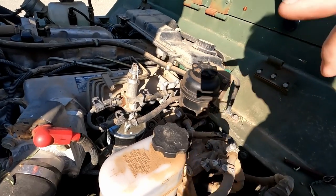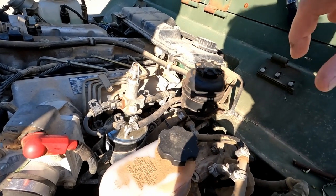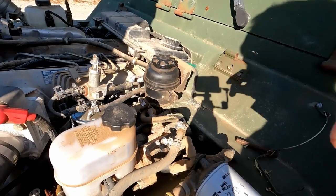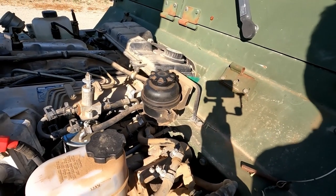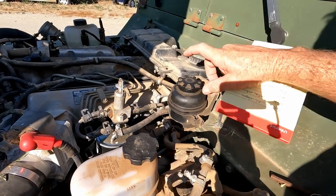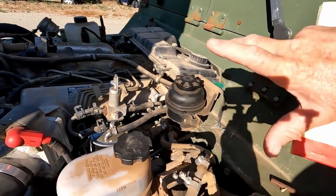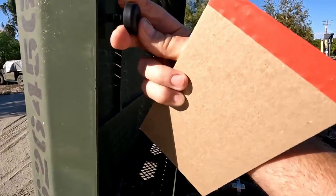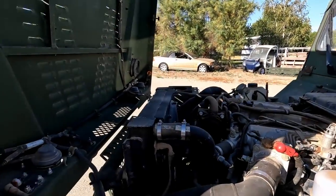We changed the front steering on this, which was good that he did do that, because his front steering unit was actually broken, and so it's been replaced now with the updated Sweet Manufacturing unit. And we also added the missing rear steer unit, so we had to bleed the steering system out and got all that stuff done. Hood rubbers, I put new hood rubbers on here, adjusted the tension on the hood.